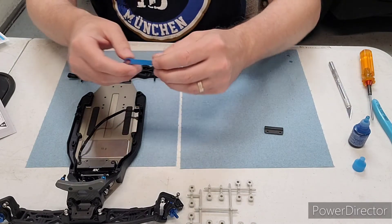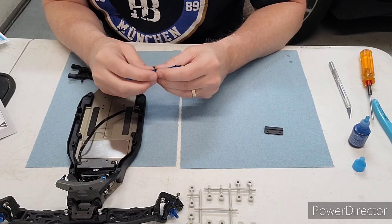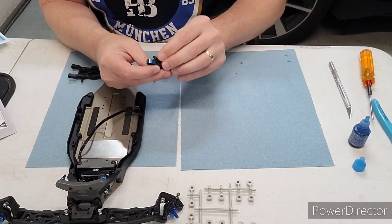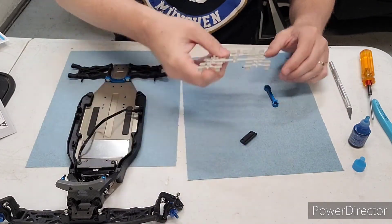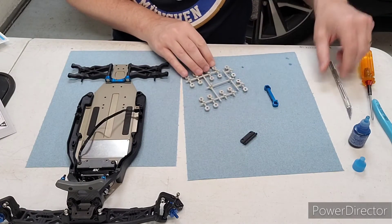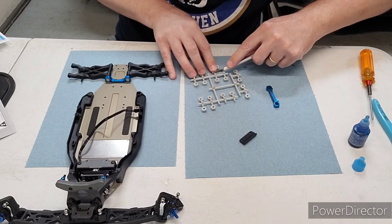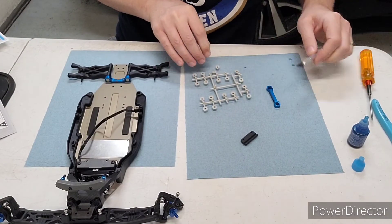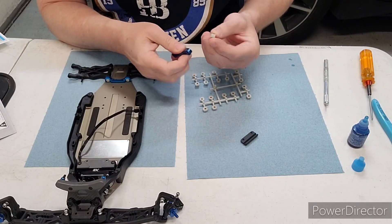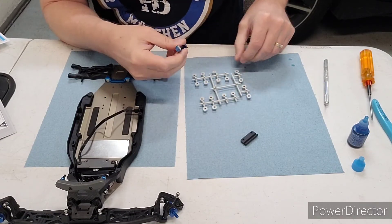The next thing is to put this D-block in. You can see again there's a recessed side, which is the side the pills go in, and then there's a little cutout on the bottom for the bumper to get inserted. For pills, I'm going to be doing the five-dot down, which is half a degree down. It's really critical when cutting these to make sure you fully cut off the flashings, or the pills won't go in all the way.